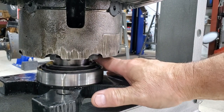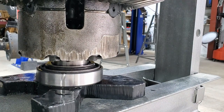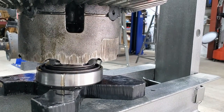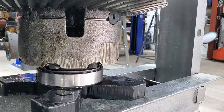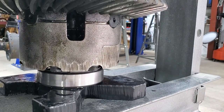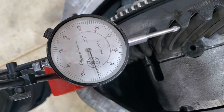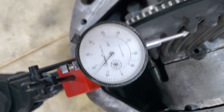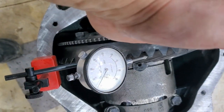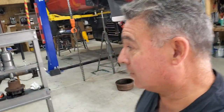We've got our shims positioned and we'll get our press going. The backlash is way too much — I need more shims over here to bring it into the pinion. I guess I get to buy a new tool. Since I had to stop and buy more tools, I'm going to buy that bearing puller and I might as well buy a case spreader to do it right.